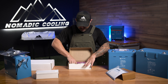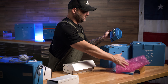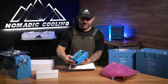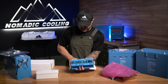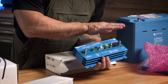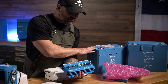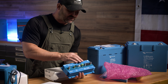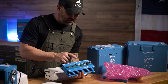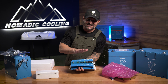I had this in my last van and it's pretty sweet. You have the m8 cable in and out ports right here. You have input from the alternator into the BMS, and then right out into your battery bank. This will program up to 100 amps, or you can program it even lower by putting in a different size fuse. It's now Bluetooth so you can control it on your app as well.